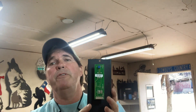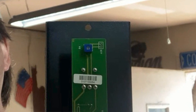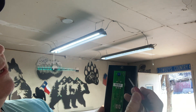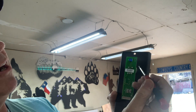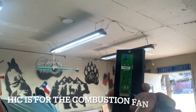Most of you have probably never seen the back of your board before. There is a setting back here that allows you to make multiple adjustments just by turning one screw. On the back of the user board there are two test points at the top, two test points right in the center, and two test points at the bottom. They are marked: the top is marked 'air,' the center is marked 'auger,' and the bottom is marked 'HIC' — hall IC.